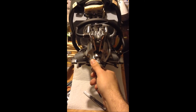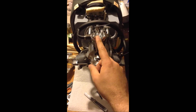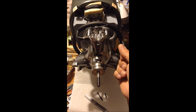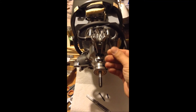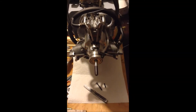So I talked to Horizon, and they suggested that I'm having corrosion buildup between the rocker arm and the valve spring, or the top of the valve. They suggested I take the rocker arm off and sand it with a fine grit sandpaper to take the polish off of it. So I'm going to crack these off — I've got my tools down here.